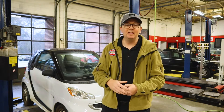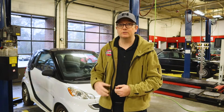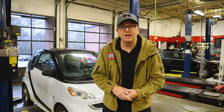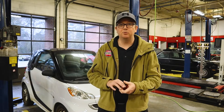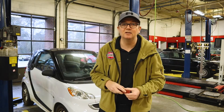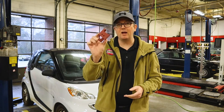I went to look this up and the information on this is very, very low — there's not a whole lot of information out there on this car. So I just want to do this video real quick and show you guys how to disconnect the high voltage electric system on this car. I pulled it in, I looked around, it's not really in an obvious position, and the plug that we pull out is not orange. I was looking for this big orange plug like most electric and hybrid vehicles have, but this one is a brownish-red color, so it's not really an obvious disconnect.